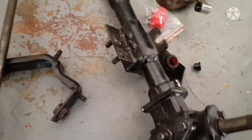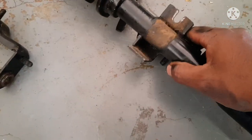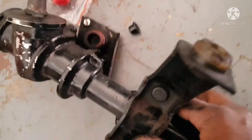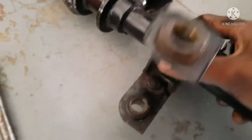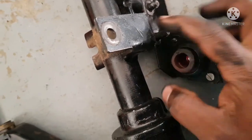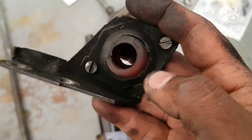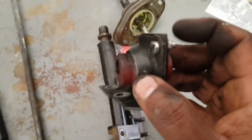Okay guys, so here we've got the steering rack — you can see how your steering rack looks. Drive side, rest on your side. This here — as you guys can see, it's got a point there, slides in at the top here. It's got a bolt underneath and a bolt here at the back — that's where your shaft fits through. If we turn this upside down and look from underneath, this is the red bush that I spoke about, it's in there. Two 13mm bolts. To change this bush is quite easy — it's got a flat screw here with a nut in the back; it's two pieces. Open it up, spread it apart, slide in your new bush, put the top piece back on, and tighten it. That's it.